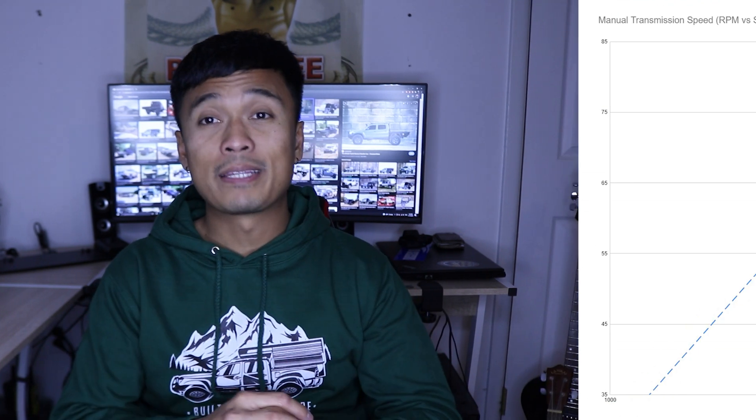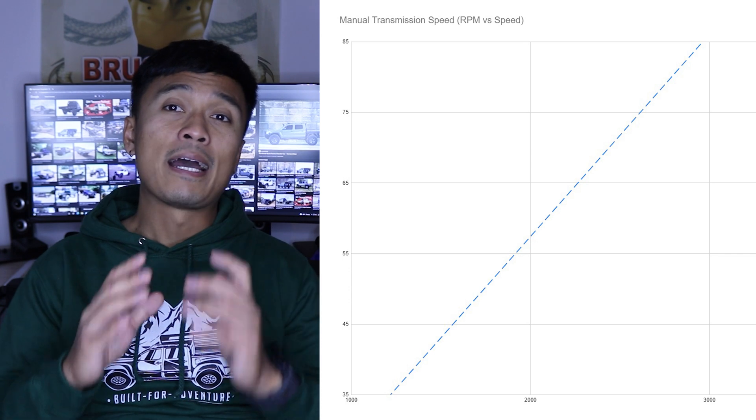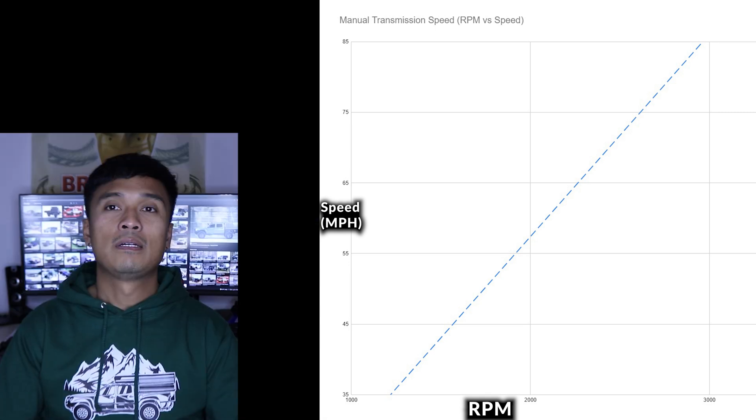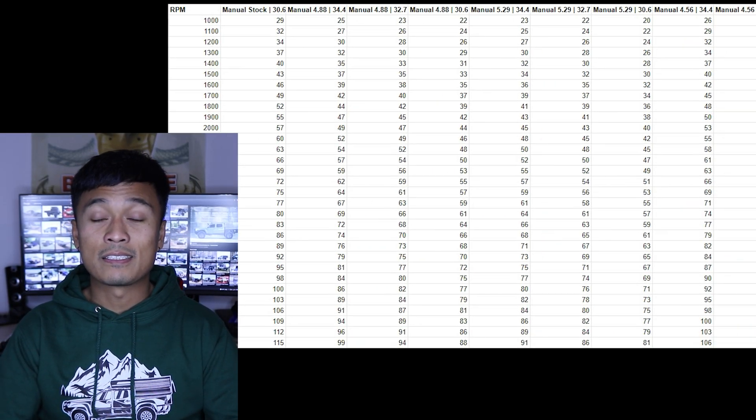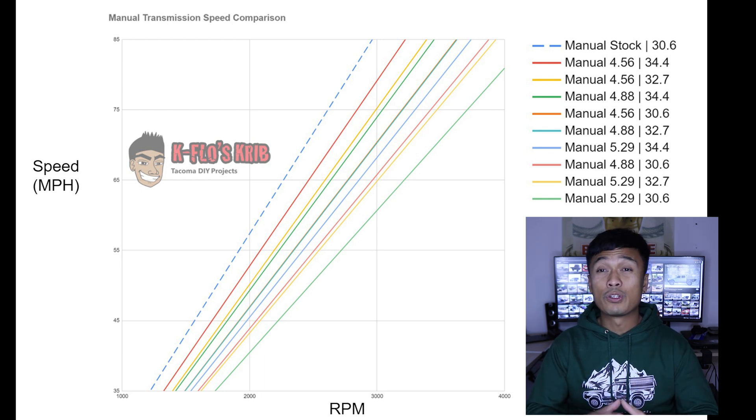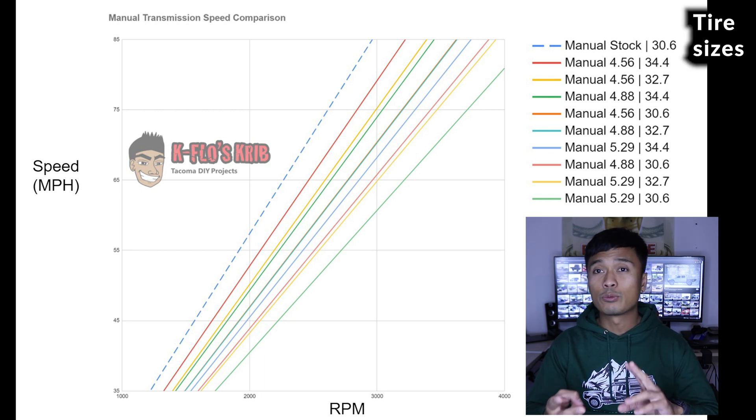Now that we know how to get the wheel and tire speed at a certain RPM, we can put that on an Excel spreadsheet with RPM on one side and wheel/tire speed on the other — just for stock wheel and tire size. We can then plot that on a chart with the x-axis as engine RPMs and the y-axis as truck speed. We can also add varying wheel and tire sizes as well as re-gearing choices, and this chart basically tells you how high your RPMs are at highway speeds with the various tire and gear choices you make.